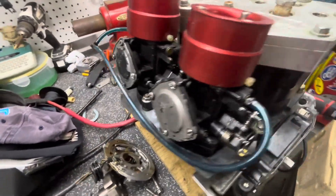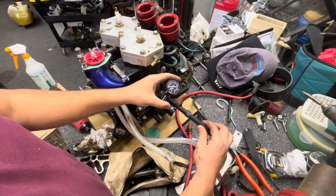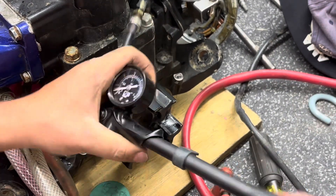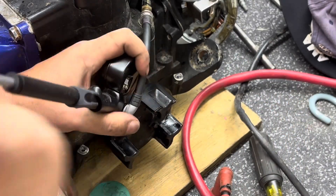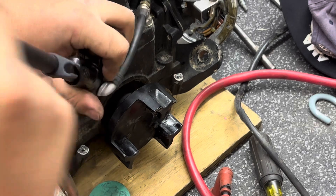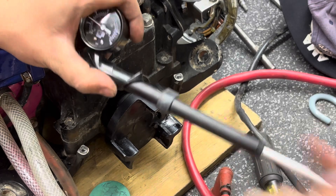Now the carbs are snugged back down. I use a pop-off pressure gauge as my pump. Hook this up to your pulse line — if you have dual pulse lines, block one off. Then bump it up. People say five to eight PSI; some others say eight to ten. I always put it at eight. It's supposed to sit — people say three minutes, others say five minutes. I've always just let it sit until I see it drop. Most of the time if you have a good seal it shouldn't leak at all, and if you have a bad seal you'll notice it right away — the needle should drop.